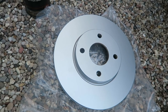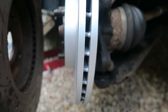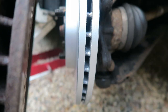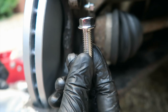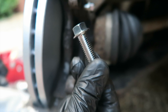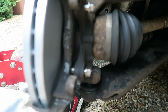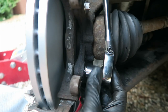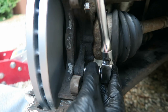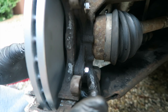So I've gone for the Pagid on the front. All you need to do when you get them out is give them a little spray with brake cleaner and wipe down on both sides to get rid of any delivery grease. In comparison that's the new disc and that's the old disc - the old ones were drilled and grooved but they're proper rotten, so I just wanted rid of them. I've cleaned up the carrier and got new bolts from Racebolt on eBay. I measured the size and got these ones - I'll put the size in the description. The original ones on the Fiesta are a 13 but these supplied ones are actually a 12, so we'll see. I'll put some blue thread locker on them to keep them secure.